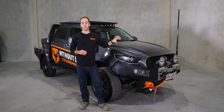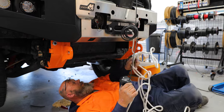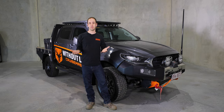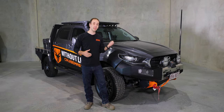Also in the bar is the 12,000 pound winch that we had from last year, except this year we've changed it over to Maxtrax rope. The idea of that rope is that you can minimize the amount of metallic parts in the recovery system, so the idea is to use soft shackles and that type of thing on that rope.